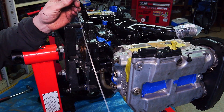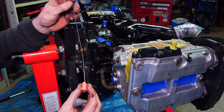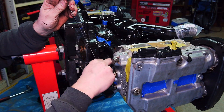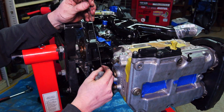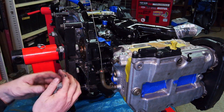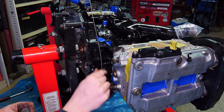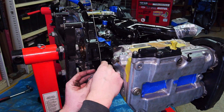I've got a bit of 1.6mm stainless TIG wire with a regular ear-protection earbud hooked onto it, and I'm just going to push that down into there like so. That will basically form a seal, and then once I've done sanding, I can pull it out and it will pull all the debris out with it — in theory.